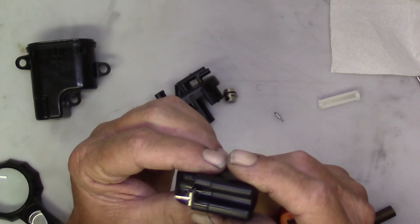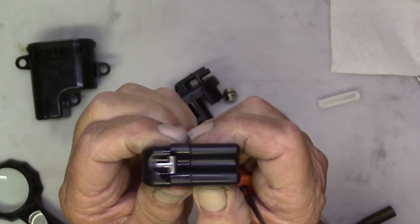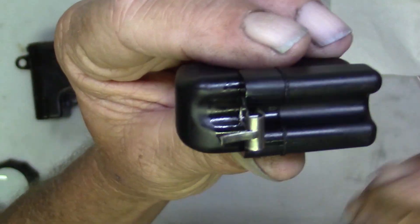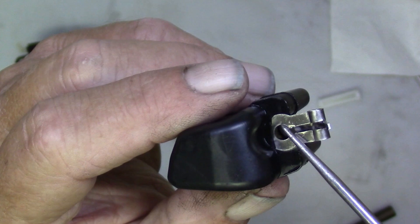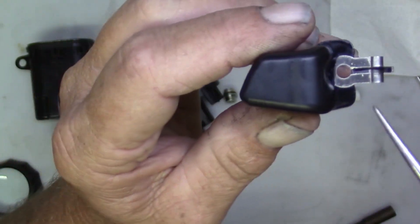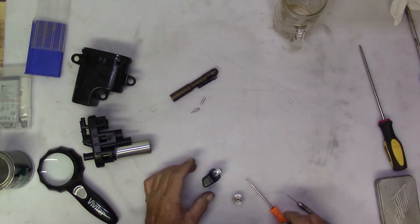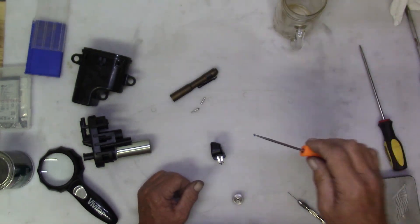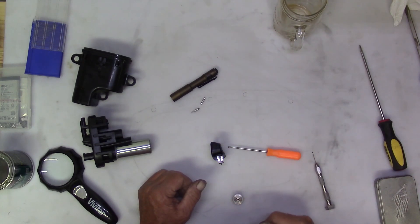I took this upstairs and washed it with soap and water, got it all dry. It's real hard and I can apply a little pressure to it. As you can see, it's dry all the way around that seam where you'd think it would leak. But if you look up here, you can see where the gas is coming out right around this metal piece. The gas pours over the top of this and down into the bowl, so over the course of time it's filled this thing up with gas. Now I need to get the gas out of it. I found the tiniest screw from my computer hardware collection, and I'm going to drill a hole in the top and try to get all that gas out.